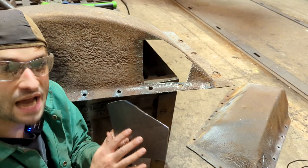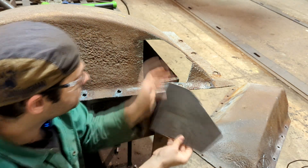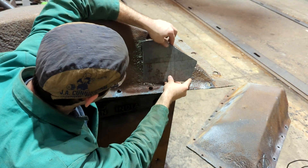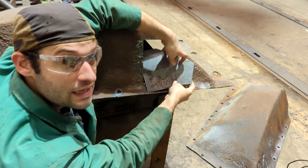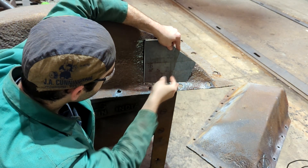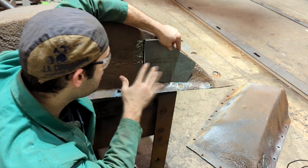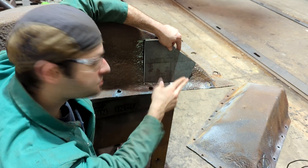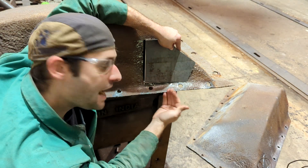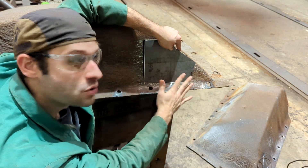Don't be upset if you go to cut this out and it still doesn't fit and needs a little bit of tweaking. On this one I had to take some material away from the top and a little bit from the bottom. First things first, you've got to make sure your template and piece fits in — the fact that it just fell inside means for the most part it's going to be good. We're going to start down in this corner and start tacking, working our way out. The most important thing is: if you just smack the metal it has a tendency to spring back unless you put a tack right where you're going to hit. If you put a tack right behind where you're going to hit and then hit it, it won't move — that's the trick. Watch your tacks, watch your spacing, watch where you put them, and then you can slowly form this to the metal that's there.